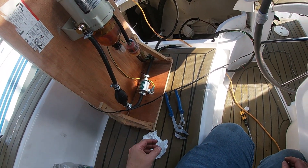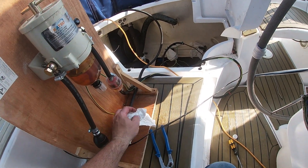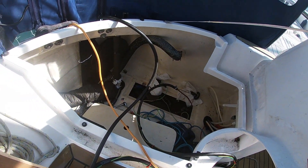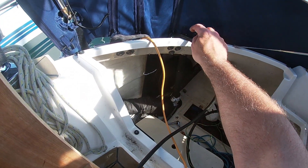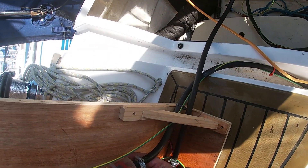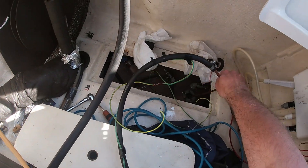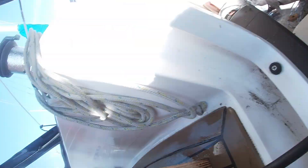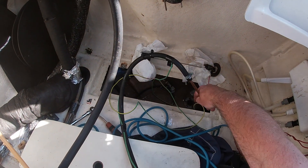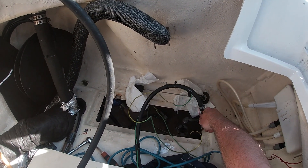The process has already started. The first thing I did was use this manual pump to prime the electric pump. I've put the inlet pipe in and the outlet pipe at the tank filling inlet, and it's already circulating. You can see the filter is already full of contamination. As I move the tube around, more debris comes out.